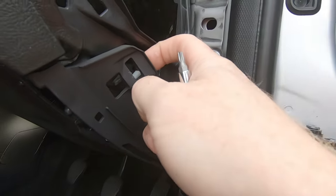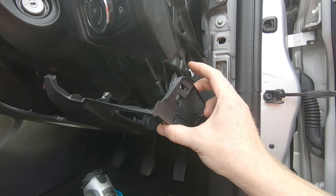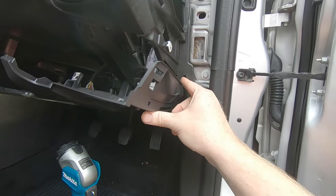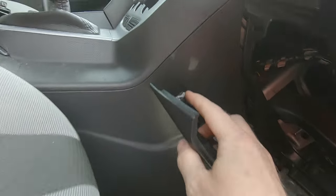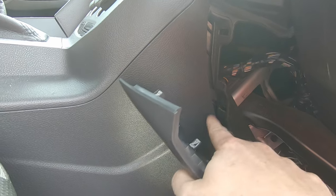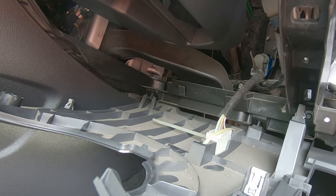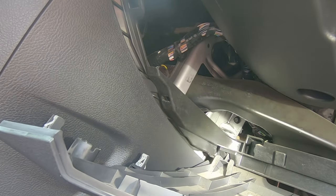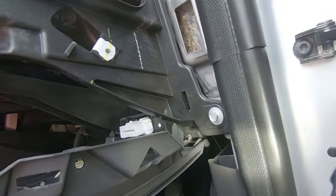That screw's out - there's only one - and then this unhooks and the whole thing pulls down. This panel itself has several clips on it. You unhook it from the side here, this little hook thing. This piece comes out of here - that's just a location piece. There's a clip here in this piece, so if you hold around here and pull that piece out. There's another clip in this top corner - you just pop that down. A bit further back from that there's another one clipped in here - you just pop that out as well. There's an electrical connector cable-tied into the plastic doing nothing - I think that's for the under-dash airbag if they have one in a foreign country, otherwise the loom is just cabled in there to stop it flapping about. In this corner there's a little arrow piece, and another little arrow piece over there, and another just in there.